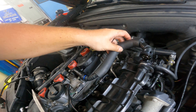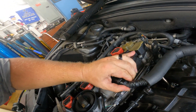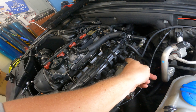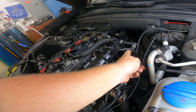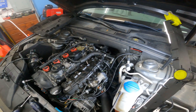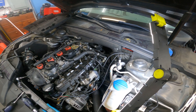Replace the vent line. Easy, quick replacement of the N80 valve — if your tubing and everything is okay, you can just buy the replacement valve, pop it off here and there, and that is definitely a lot quicker. We'll take this thing for a test drive and see if all those codes get cleared.